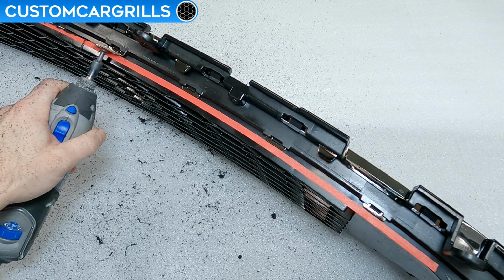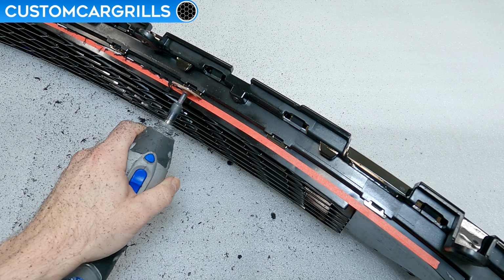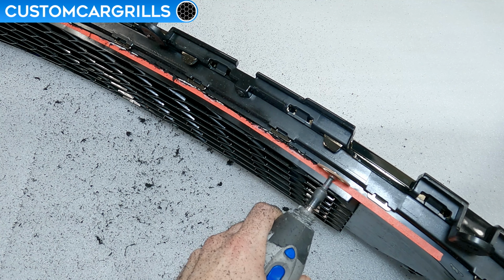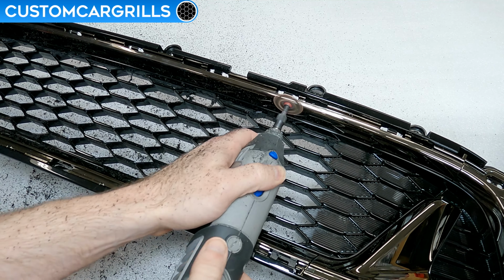To do the cutting, I'll grab my Dremel and equip their number 543 cutting and shaping wheel. This bit will cut through the plastic easily, and with the tape line, I can make some accurate cuts. The cuts should be made right up to the top of the tape line shown here, and the cutting wheel should not be cutting through the chrome tabs, at most maybe grazing them.